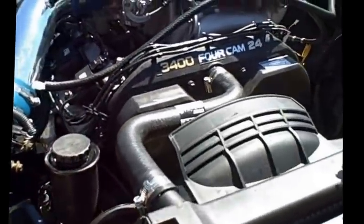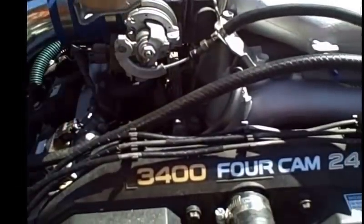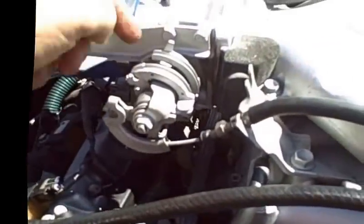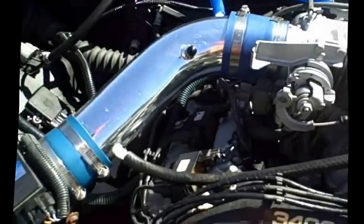One other thing I want to talk about is lubricating your throttle. I know we talked about the inside. It just kind of slipped my mind as I'm thinking about it here. But lube the heck out of these springs, your connectors, your connection to your throttle body. It just makes everything nice and smooth. If you want to, you can go ahead and lube up your cable. Just go ahead and put it up in the air. Slap some oil in it.